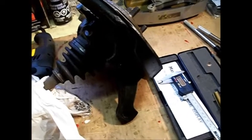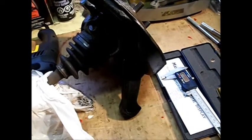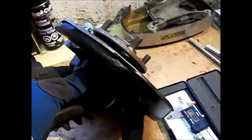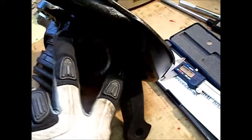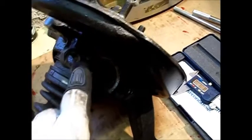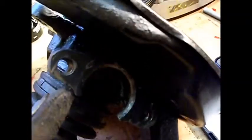In this video we're going to show you how to repair stripped threads. While I was installing my driver rear hub assembly, there are two bolts that hold the assembly to the ball joint. One wasn't really going in, and I stupidly used my impact driver to try and get that bolt in there, and what that did is totally strip all the threads. You can see down here all the threads have been totally stripped out — it's just smooth now compared to the one here that has threads.